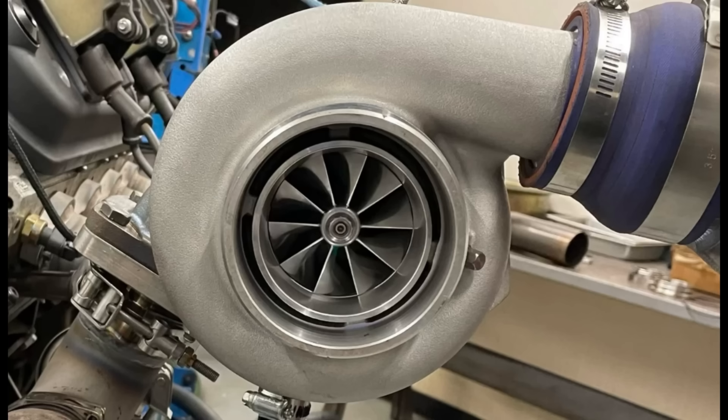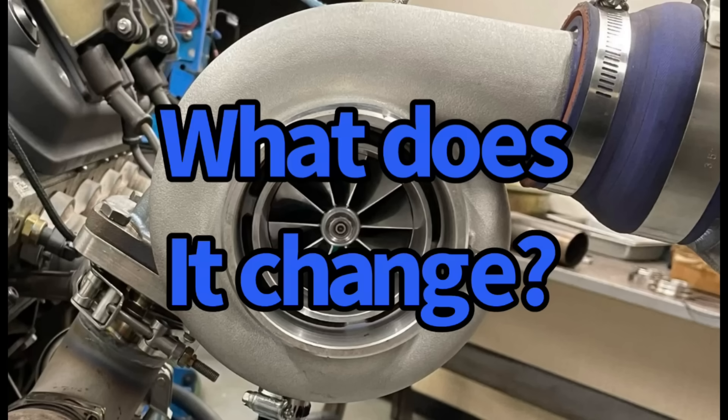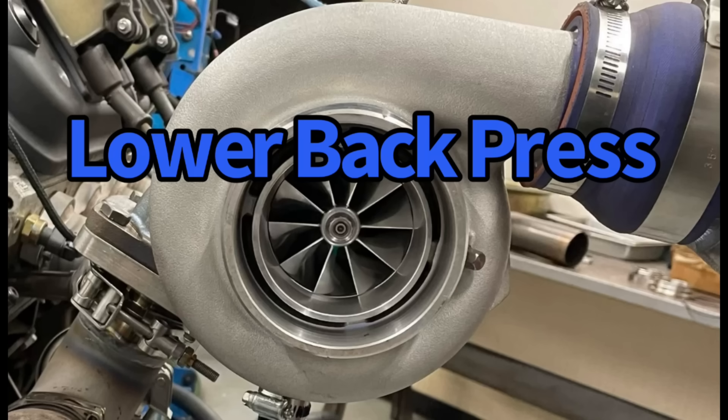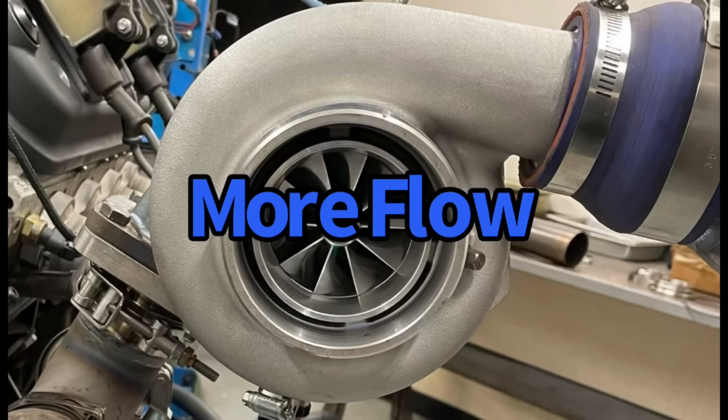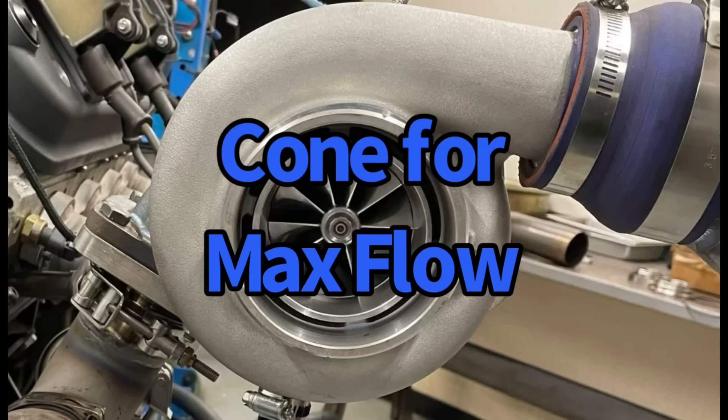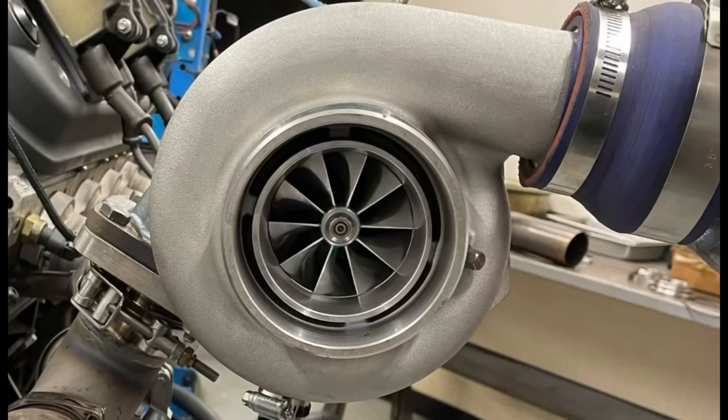Horsepower and torque were nearly equal at around 11 psi. The power cones definitely work — they affect back pressure before the turbo and flow rate after the turbo. If you're trying to maximize the power output of any turbo, coning up from the outlet size of the turbo definitely makes power. Make sure to like, share, subscribe, ring the bell, and check out RichardHoldnerPerformance.com.